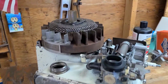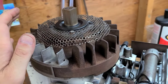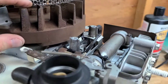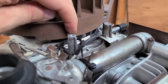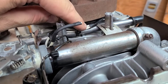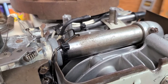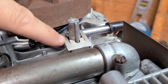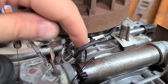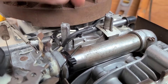The flywheel is installed with new aluminum keys, torqued to 50 foot-pounds — it's supposed to be 60 but trust me 50 is tight enough. The new starter is in place. I spun the motor a little to make sure the wires don't touch anything. I put a little electrical tape around this area because the heat shrink tubing cracked right there and it's right on this little holder, so I want to make sure nothing cuts through those wires. Everything is wire-tied in place and the male-female clip for the kill wire has tape around it so it doesn't pop apart.